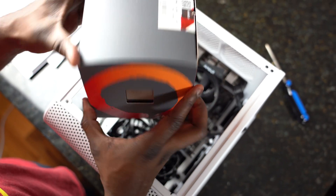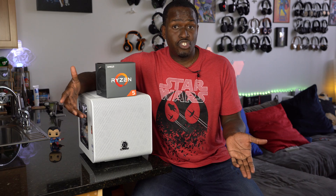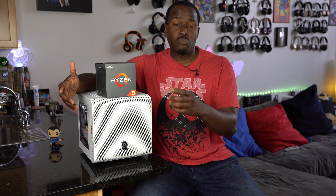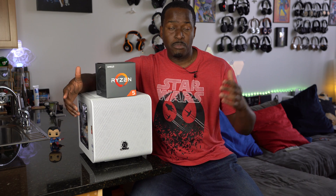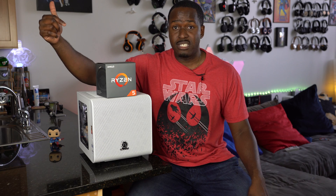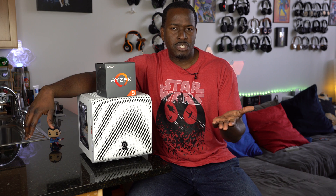The reason I want to showcase this is that the Ryzen processor is really easy to upgrade. You don't have to change your motherboard, you don't have to change much if you just want to upgrade your processor. You just have to change the chip because the Ryzen processor runs on the AM4 socket platform, so it's easy to jump from Ryzen 1 all the way to the Ryzen 2700, for example. But if you want to get more from the system, you will change the motherboard.